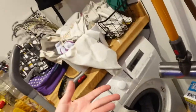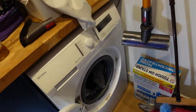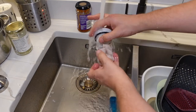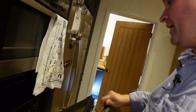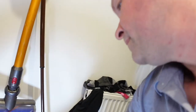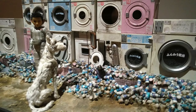It's down here. So the first thing we've got to do is clear the washing — obviously we're not going to do the washing. I want to get to that flap down there. We need a tray for this. What we're going to do is empty the filter — we'll clean the filter for the washing machine. I need a tray. Why are we doing it? Because if it gets blocked up, we'll have to call the washing machine engineer. So put the tray down — this is to stop any leaks.